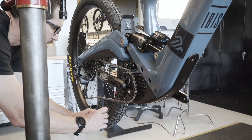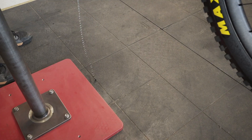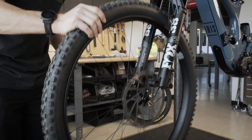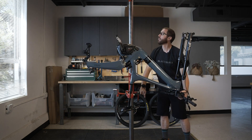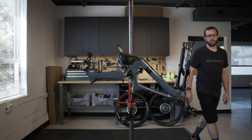To make things easier, we'll remove the chain and take off both wheels. Because we're dealing with the underside of the bike, it helps a ton to be able to put the bike vertically or even upside down, as long as you can get it low enough.